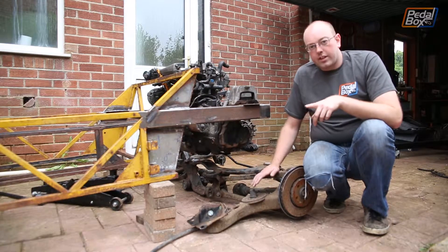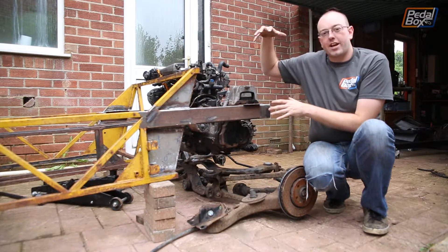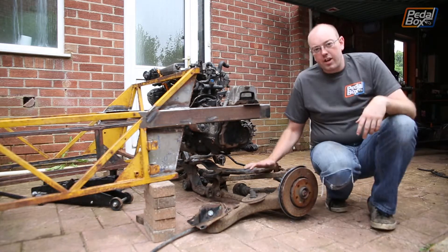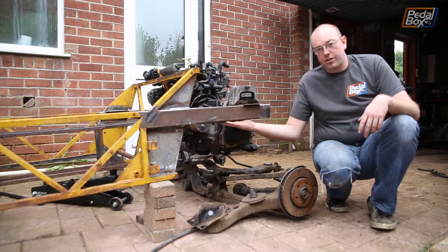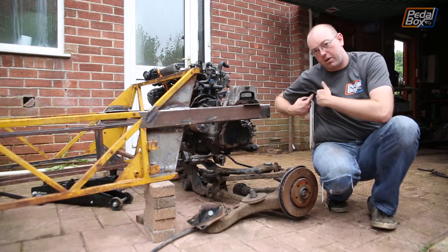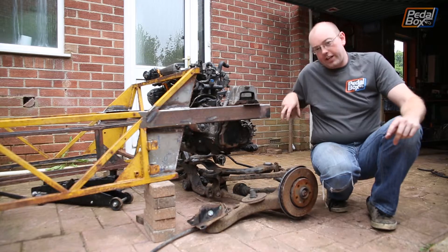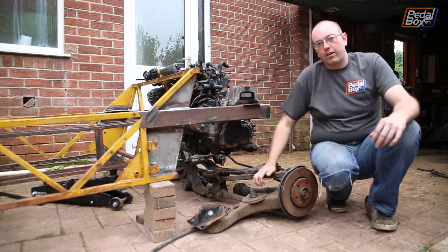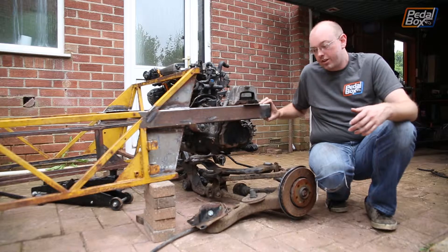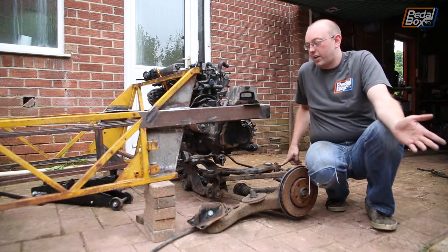The next major win that we get from using these is the suspension turrets. With the other subframe off our donor car, we'd have turrets coming up here and we'd have to build a lot of sheet metal around them to make them work effectively. But we don't need that. On the car this came off, there's a spring which sits under here and goes into part of the bodywork, and a shock absorber that mounts at the very back of the hub and comes up roughly into my chest — and that's also where the ARB mounts. We can put our shock here and we don't have to deal with a massive tower around the top, which makes fabrication hopefully a lot simpler. We're going to have to extend the legs back a little bit further to get to the gearbox mount and the ARB, but that's not actually a terrible thing.